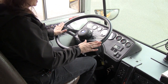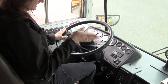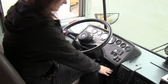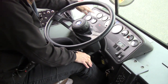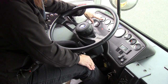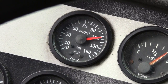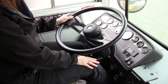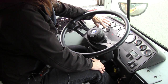That completes the outside of the bus. Now we're going to check our air supply system, and this is one of the have-to things, so you have to know the exact numbers you're looking for. With the engine off, we're going to release the parking brake — make sure your foot is on the service brake — and we're watching the initial drop. After the initial drop, it cannot move more than 3 psi in one minute. After one minute, it did not drop more than 3 psi.